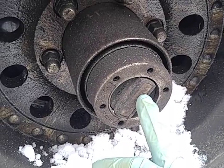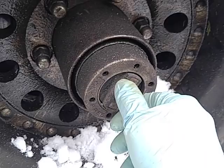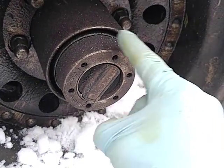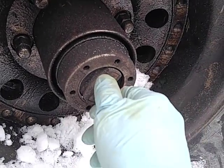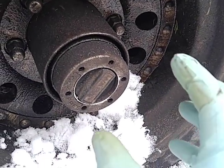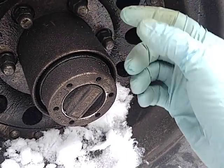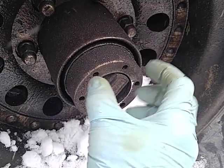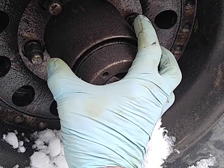What does a locking hub do? There's probably a video on YouTube that shows them in action. But when you turn the knob — this is a quick-acting one — it's threading inside. Turning clockwise, you lock it like that. It's turning and pushing teeth that engage on the other side where the axle comes through the hub, and you've got teeth that are just separated. When you turn that knob, click, you're engaging the teeth so that they mesh.